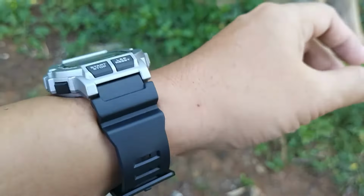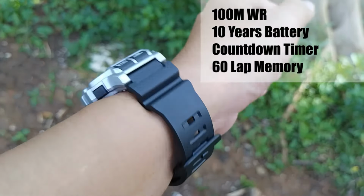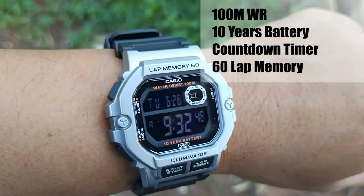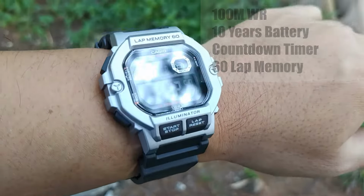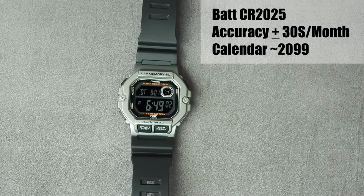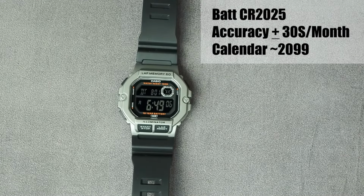The key features of this watch are 100 meters water resist, 10 years battery, countdown timer, and the main feature of this series is 60 lap memory, perfect for runners. The battery is CR2025 and accuracy is about 30 seconds per month with calendars up to 2099. We will include the other details in the description.